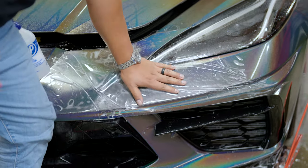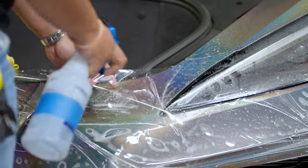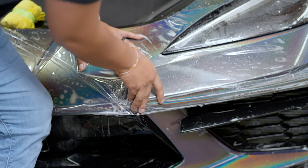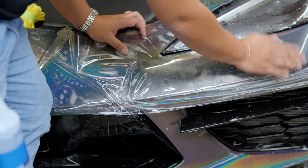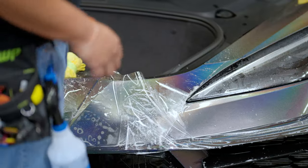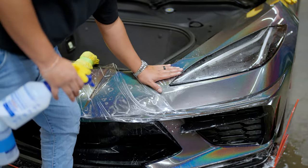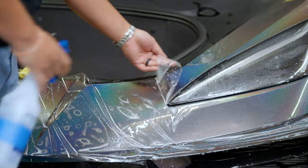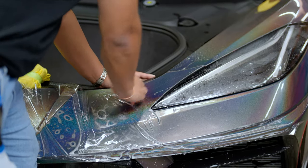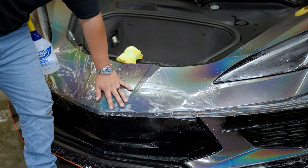So here we're going to see our film is moving freely. Line up our corners, line up our edges, make sure everything's set. And here we're going to spray our tack solution, pull it, get rid of all that tension, let it sit, and now we're going to squeegee it out. You want to spray your slip solution with hot water on the bottom, so we're going to be stretching this towards the top. Now we can spray the top with our tack solution. Once that's in place, grab your squeegee. Make sure everything's lined up — which it is. Everything's good to go for the other side, so we're just going to continue making our way over. Lift your film up, spray some tack solution.